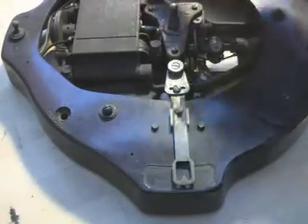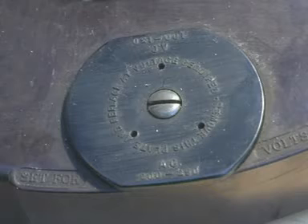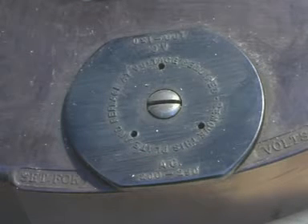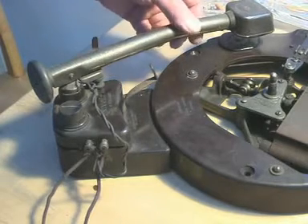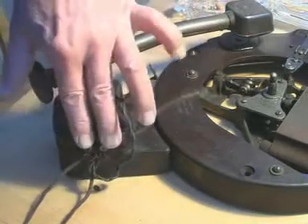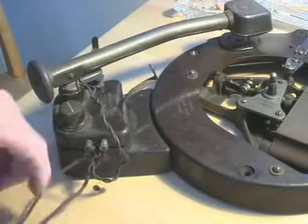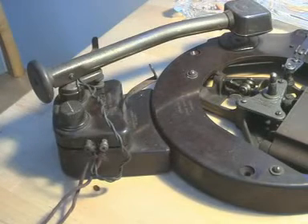Obviously the motor casing there with the coils inside it. There is a plaque here — it says set for 200 to 250 volts AC, so that's promising. Here are the wires from the head connected to two pillar terminals. There's a volume control there with a traditional pointed knob, and that's where it says 'univolt'. The wires from these pillar terminals went through ordinary twisted flex and were plugged into the back of your radio set.